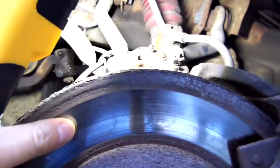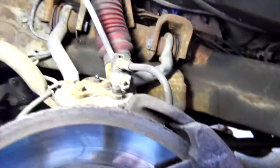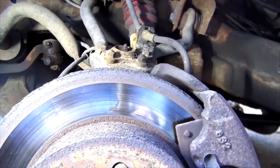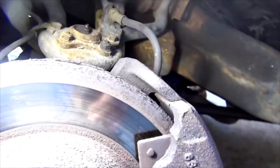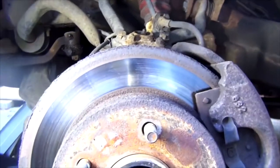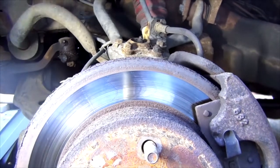You can inspect for any fracture cracks — that's going to tell you about other problems. Look for inconsistent braking and hot spots, which are very obvious. It could also be your ABS acting up. Look for even pad wear: mine wasn't even, so make sure there's not more wear on one side than the other horizontally.